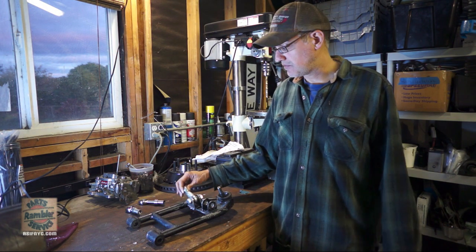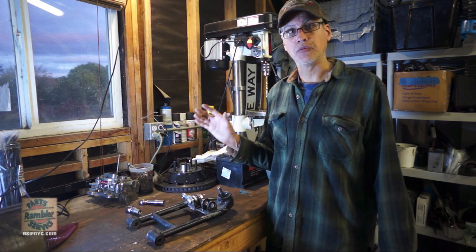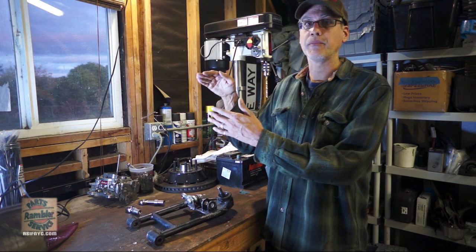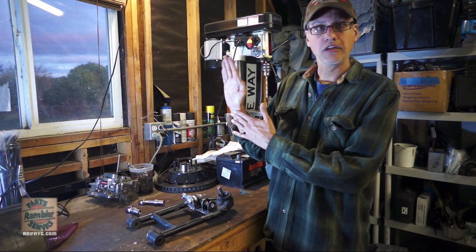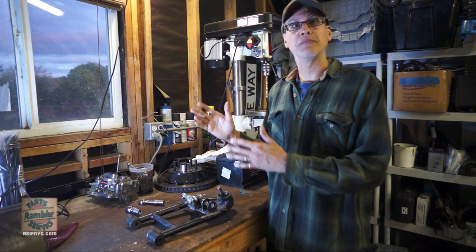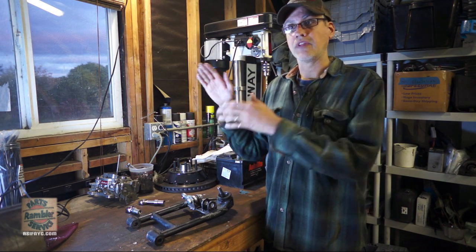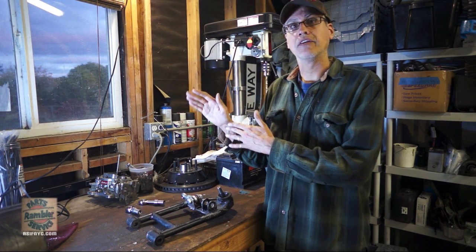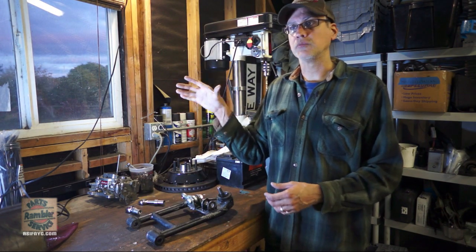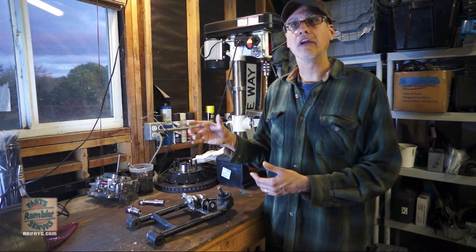I've been trying to figure out how to do that. Originally my plan was to take the upper control arms, which are adjustable, but I had them as short as they could be. The shorter the upper control arm is, the more it brings the top of the tire towards the centerline of the car, giving you more negative camber. But I had no more adjustment, and my idea to cut a bit off the arms won't work because the upper control arm is already so tight around the spring — you physically can't get it any closer to the body without interfering with the coilover.